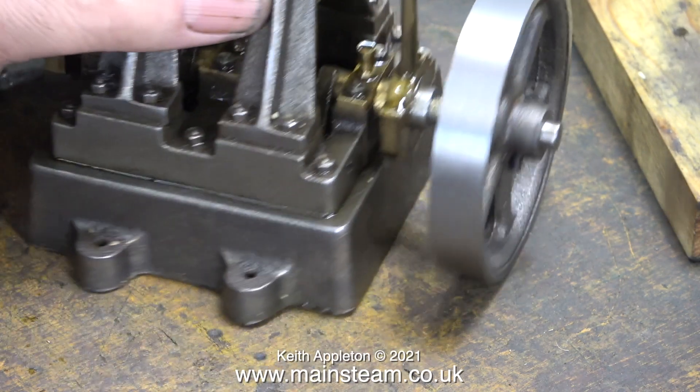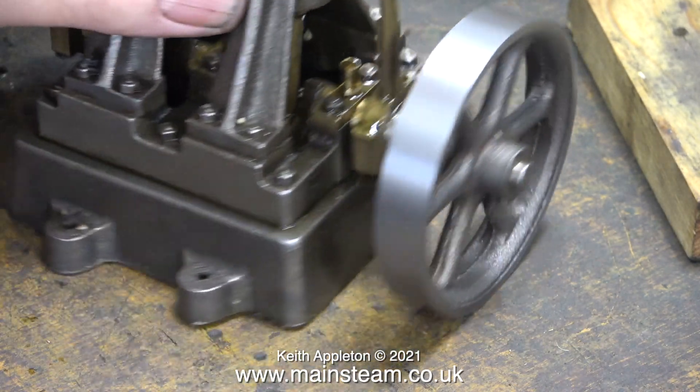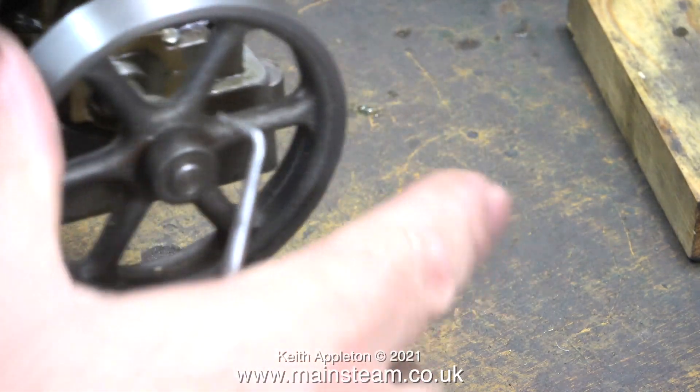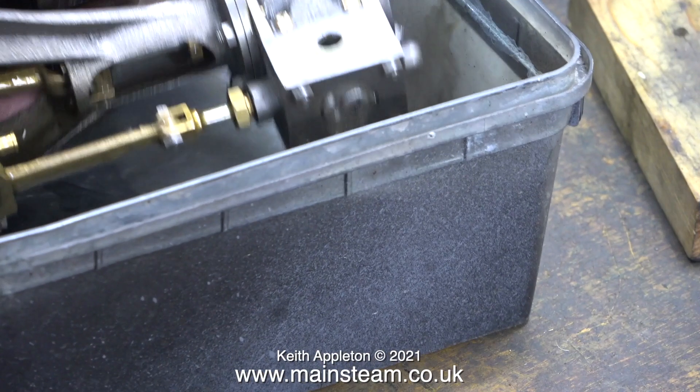This is the reason I've worked on a lot of Double 10s with bent crankshafts. The flywheel protrudes below the level of the box bed, and if you don't notice this and screw the engine down to a baseboard, you bend the crankshaft. To prevent that, for the further work I'm going to do on the engine I'm removing the flywheel. Now the box bed sits squarely on the bench.